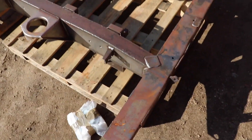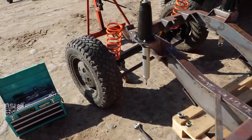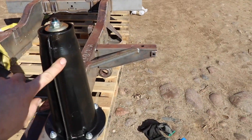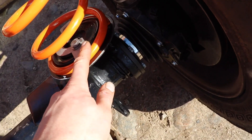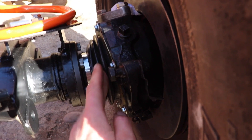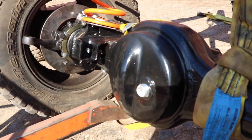As you can see right now we've got this chassis outside. It's not galvanized yet but will be galvanized once we've made all the mounts for the engine and gearbox. I've just started on the first front axle here — nice new shiny bits. All of them are galvanized, stainless steel. And I've got these gators here as well on the front bit to stop mud and stuff going into the swivels. Other than that, the axles are completely new more or less.